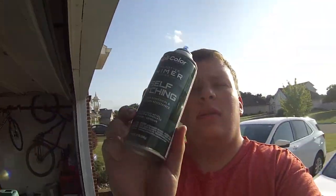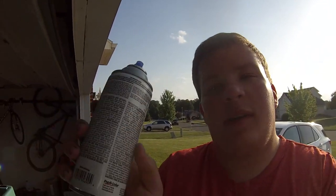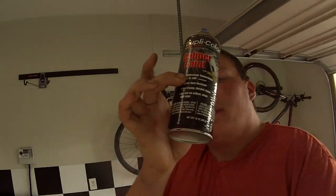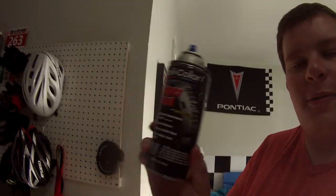That came bare metal off eBay. I painted it with some self-etching primer - sanded it first with 320 as the instructions recommend. Then I had some caliper paint and painted it with that. Caliper paint is a little more durable than regular spray paint and withstands 500 degree temperatures. Since the exhaust is going to be real close to the trans cross member, I figured it might help from the paint boiling off.